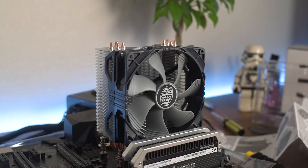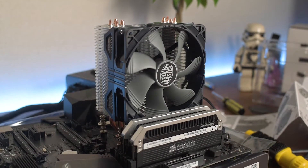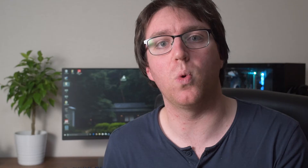The Cooler Master was actually quite a bit quieter as well, and I think this is all down to the fan. The fan on the 212X can ramp up to about 2,000 RPM whereas the H7 is limited to about 1,500 RPM, so there's a lot more headroom available in the 212X. When it comes to straight-out performance, the 212X is definitely the better bet.